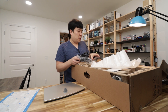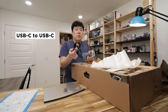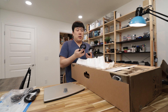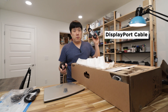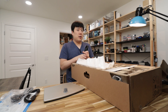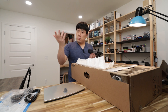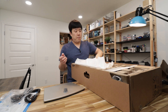There's no HDMI port present, but I'm gonna utilize the USB Type-C to C cable to connect to my laptop, which is the easiest way. Keep in mind you've still got to power the monitor with the power cable, and data can transfer between USB Type-C to Type-A port onto the monitor, and DisplayPort to DisplayPort if you're on a desktop or if your laptop doesn't support display over USB Type-C. In that case you need two cables connected. Otherwise, a single cable setup is tidier and less hassle. I'm not going to use those two cables, so I'll put them back.